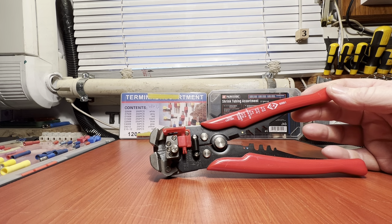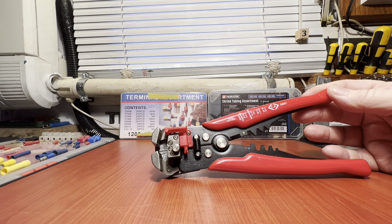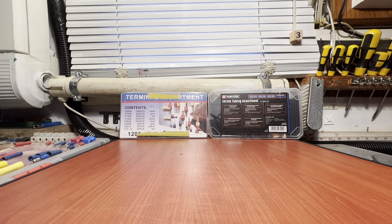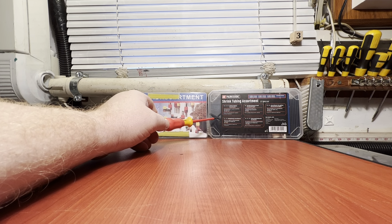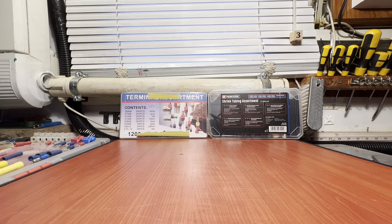What I'll do is I'm going to show you some crimps, I'll show you what crimps I've got, then I'll show you the ferrules. We'll do some crimping, and then I'll show you how to put a ferrule on, and what a ferrule is for people that don't know, and then we'll put it on wire for you. I've got shrink tubing there. You put that on your wire once it's on so that you can put heat to it and it'll seal the cable so the water can't get into it, but you'll see that.